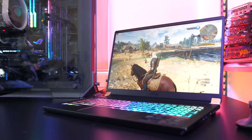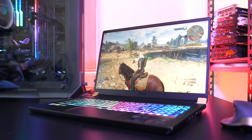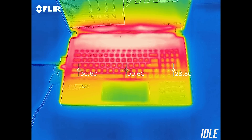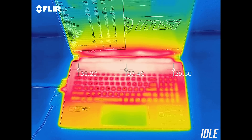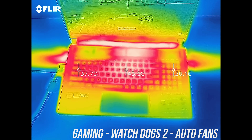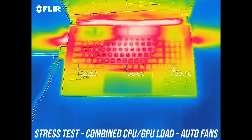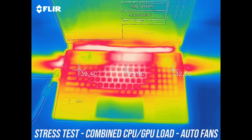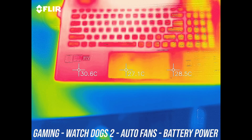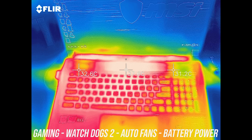If you're after more gaming benchmarks from the MSI GS75, check the card in the top right where I've tested 20 different games. As for the external temperatures where you'll actually be putting your hands — at idle it was a bit warmer than average in the middle, getting to the mid 30s. While gaming the center of the keyboard gets to the mid 40s and is warm to the touch but not hot, with similar results during the stress tests, and a slightly warmer spot in the middle up the back where the power button is. While gaming on battery power the left-hand wrist rest area warms up, as the discharging battery is directly underneath.